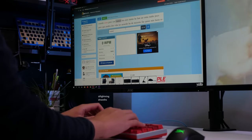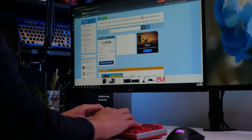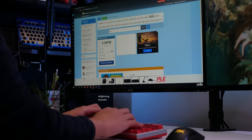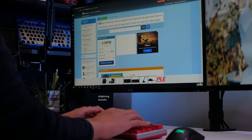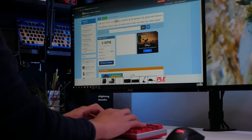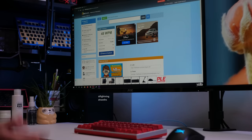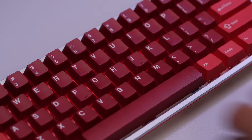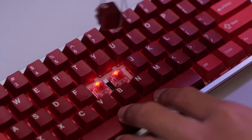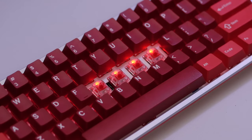I did find the HyperX Red switch to be decently smooth for a stock switch, certainly much better than a Cherry MX Red, which it's based off. And with the lube, it feels fantastic. Not the smoothest switch out there, but pretty damn smooth and satisfying. The 55 to 62 gram phase springs are pretty weird though. I kinda wish I used something a bit more normal so that it would be easier to compare, but it's what I had on hand and I thought I might as well.